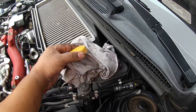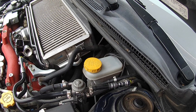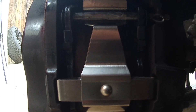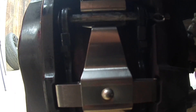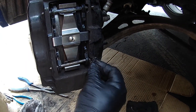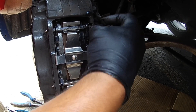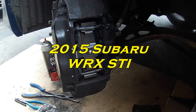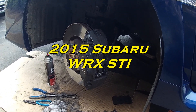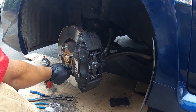Don't forget to put the cap back onto the brake reservoir bottle. Because if you don't do that and you go to push your brake, you are going to have brake fluid spill everywhere — go shooting everywhere under your hood. Put the cap back on the brake reservoir bottle. Then go inside and push the brake pedal ten times before you put the wheels back on, because you need to have the new pads make contact with the rotors so that you actually have brakes when you brake for the first time. Got our clevis pin — bring that into place, push it down, make sure it is secure. Do the same thing on top. I am going to torque the lug nuts down to 80 foot pounds.